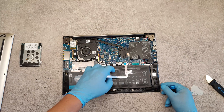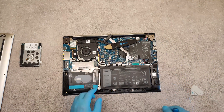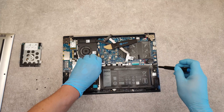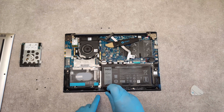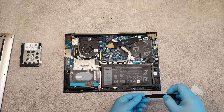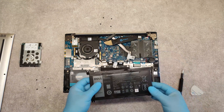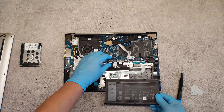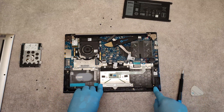To replace the battery, push aside this cable. We have to unscrew these two screws, then unscrew also these two screws, and we are ready to take it out. Disconnect this connector — and this is our old battery. In reverse order, place the new battery, plug in the connector, and screw the screws back.